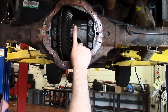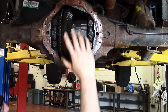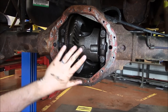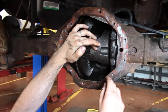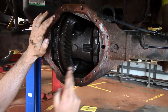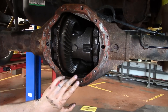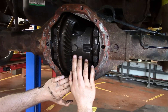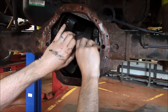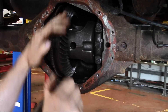Step five, we're going to remove the diff pin. This is the hole the bolt came out of. We actually spun this hole up so we had access to the other side of the pin. This pin has been abused and it's not sliding out clean. We took a socket and tapped it against the bottom of the pin to drive it out. Now I have access to the hole in the pin, so I'm going to put the retaining bolt in there and twist it a little bit to pull the diff pin out.